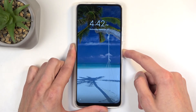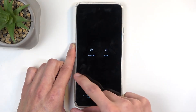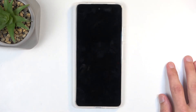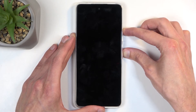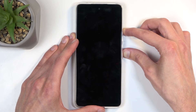To do so, no matter if you're on a lock screen or not, just hold the power button until you get the boot options. First time around you will get a Google prompt show up — you can keep holding and ignore that, then press the power button. Once the device turns off, indicated by a vibration, hold the power button and volume up at the same time. Once you have the Nubia logo on the screen, let go of the power button but keep holding volume up.